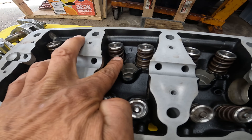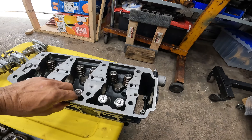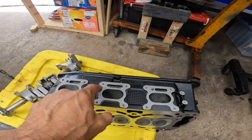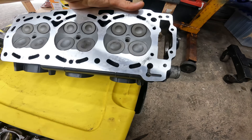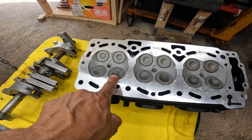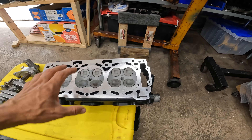The head has retainer stock springs but the stock springs are rusty and pitted — not going to use these. The valves: the head supposedly was done, it looked like it was sandblasted and done at a machine shop somewhere. They used stock valves which are clean, but you can tell they are pitted. We'll get to this later.